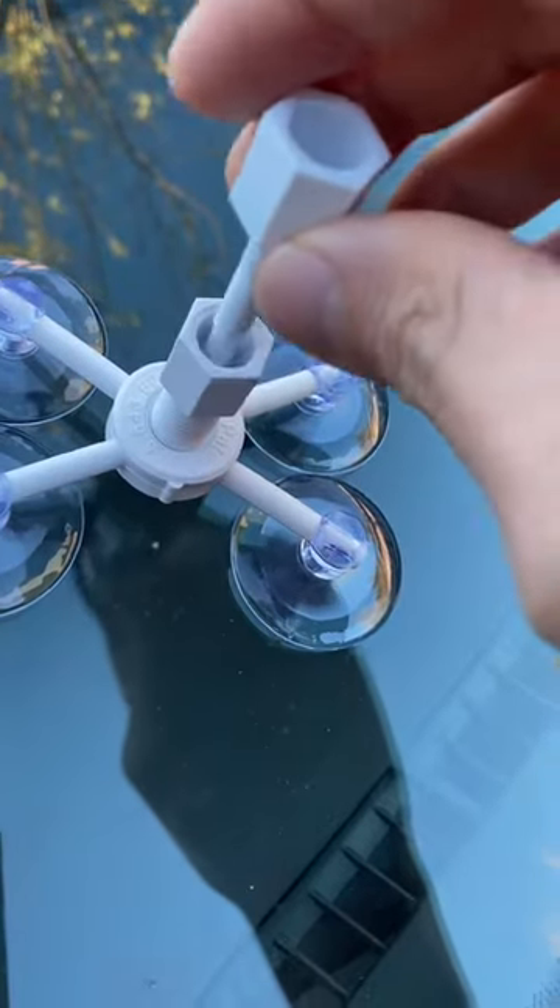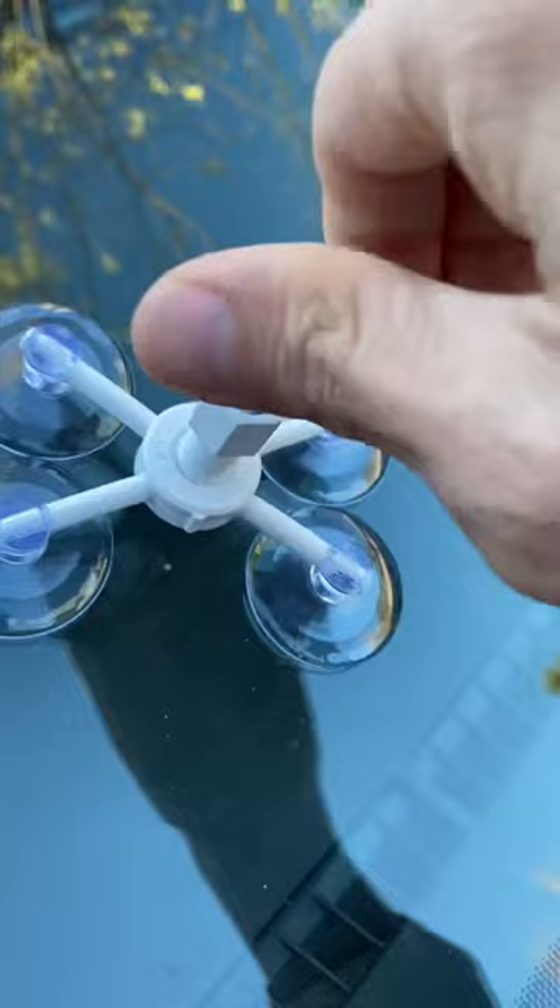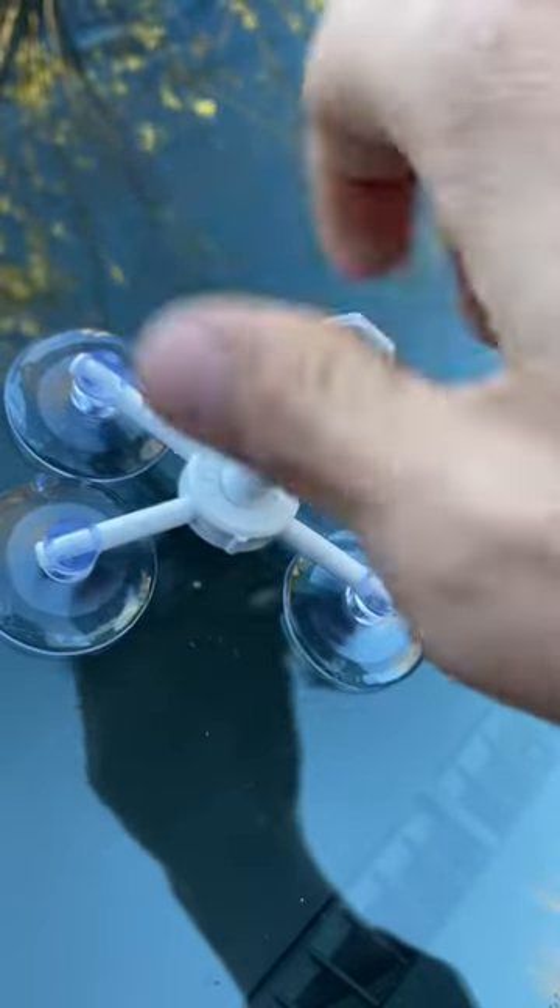Then it's time to press the resin into the crack, and that's what this piece is for. As you screw it in, some of you might see liquid seep at the bottom. If so, no big deal — wipe off the excess and screw the bottom piece more firmly against the glass.